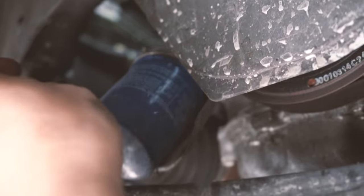Also take into consideration that the oil filter needs more oil to be circulated inside. So once I start the engine and let it run for a little bit, the oil level might dip a little more. So this one can is definitely enough to cover whatever you need for an oil change, but just make sure you don't overfill the oil. Make sure it's at the maximum level, but don't ever overfill the oil. This is all going to come out from the air filter part, which is going to be really nasty.